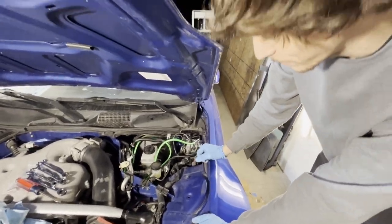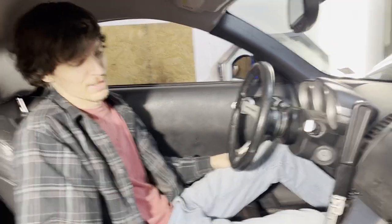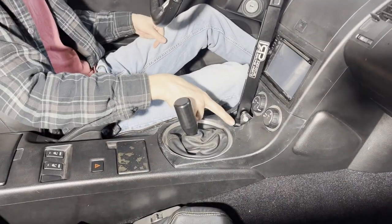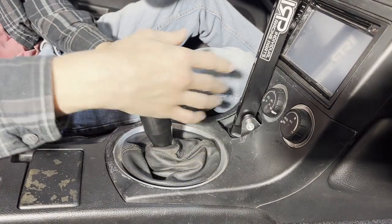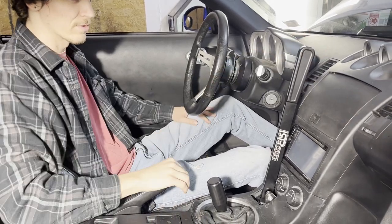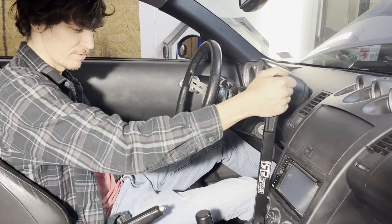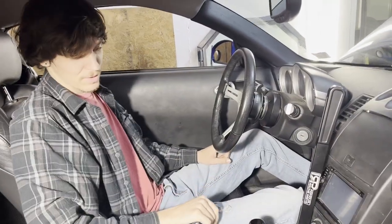It's another day — we ran out of time last night but finished it up today. I put the center console in and cut out around the handbrake; the hole's a little big but it works. There's really not that much throw on it. I was a bit worried because it's the smaller 0.6 master — there's a 0.6 and a 0.75, and the three-quarter is a bit stiffer — but this seems okay. Next weekend we're ripping the handbrake at the drift event. Hopefully this helped somebody — it's a bit of a unique approach, so thanks for watching, like, comment, subscribe.